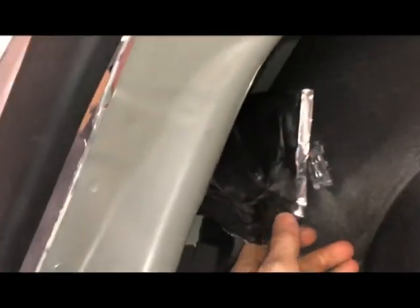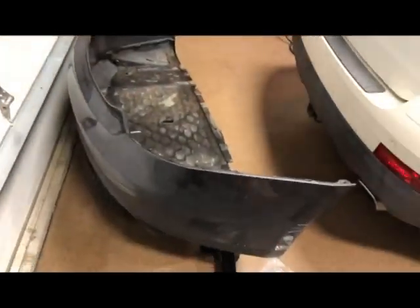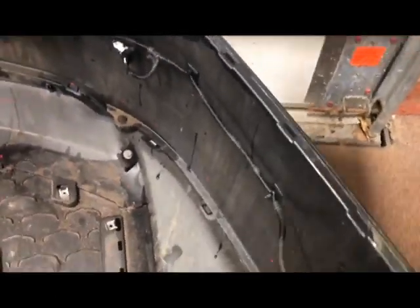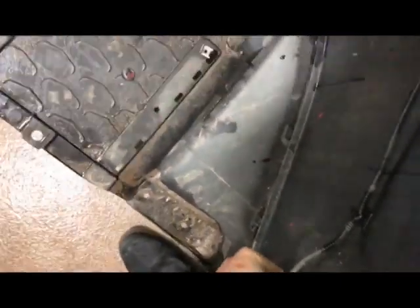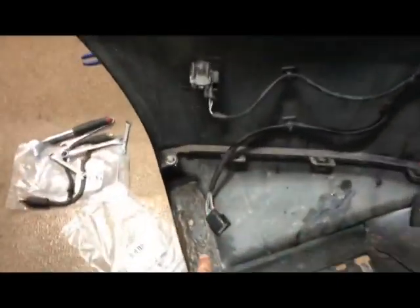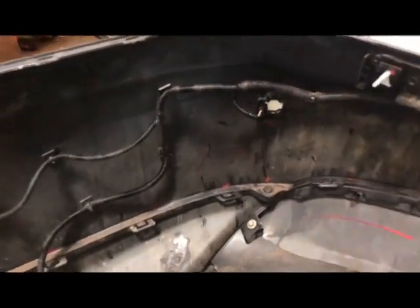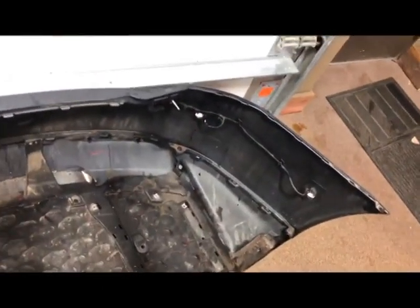Trying to keep my car nice — there's the fastener and I just peeled this down; luckily it came off okay. There's one on this side too, so whip those out and the bumper should be loose. That was a little unpleasant, but really well designed — all of the parking sensors are on a single disconnectable loom, so I definitely don't bother disconnecting those ahead of time. And that is probably the biggest single-piece bumper I have ever seen.